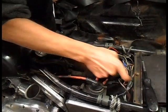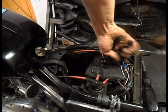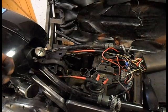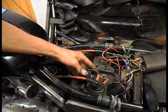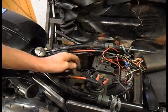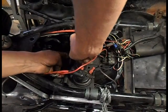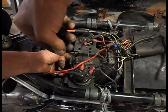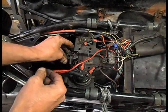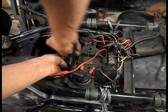Bolt under the back there, I think. Yep. There's my rectifier. My Zener's down in the standard place down here. So I'll be removing all of them and I'll give them a test as well. Here's my rectifier, so I'll just whip that out. Pull that off. Oh, in fact, I think I can see my trouble.